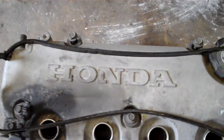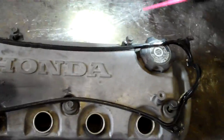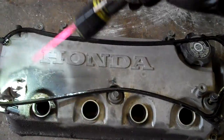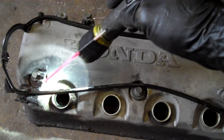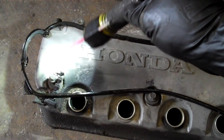The first thing you want to do — you'll notice this doesn't look like yours, yours looks more like this. You want to pull the five bolts and the hose off. The five bolts are this one, that, that, that, and that. Also take the spark plug wires out and feed them off of this, as it blocks access to this bolt and this little loom holder. Bend that slightly to the right and just leave it that way — that's the best way to service it.